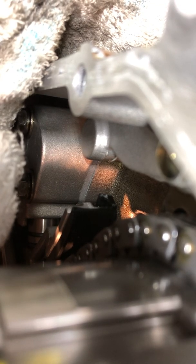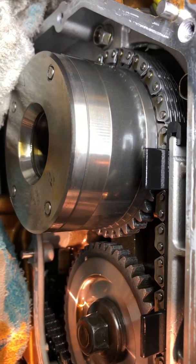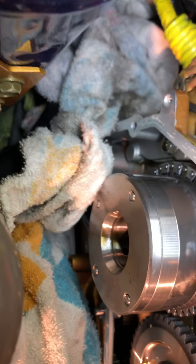I'm going to make it so that plunger can't go in any more than what it's already at. And I'm going to have to install it slightly differently than what's recommended — I'm going to install it with the plunger already popped out, so that when I crank this car on a cold start before I have any oil pressure, I can make sure that the chain is somewhat tight. It should never be loose under any condition.